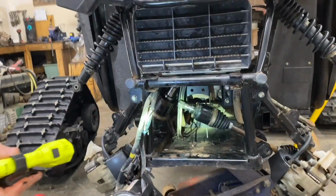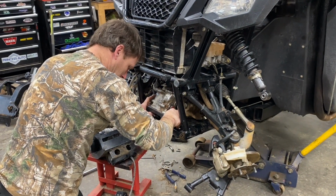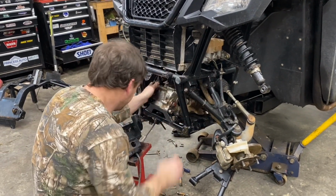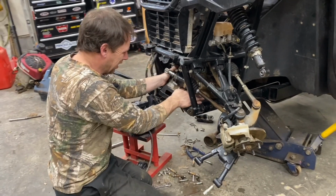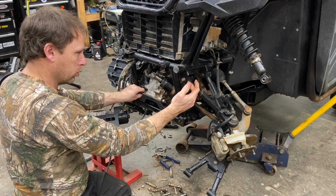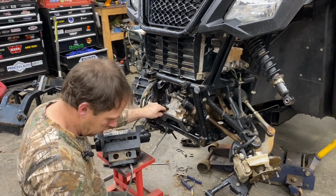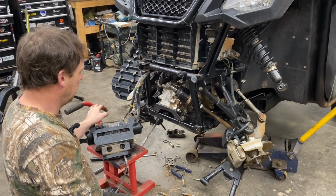And just slip the front end straight in there, down to that shaft way in the back. Yeah, I think you could get it if you had to, but you really want the help. You gotta remember these upper control arm bolts when you're done, because we loosened them off and left them in the hole, so it'd be easy to forget. Anyways, that's back in there loosely.